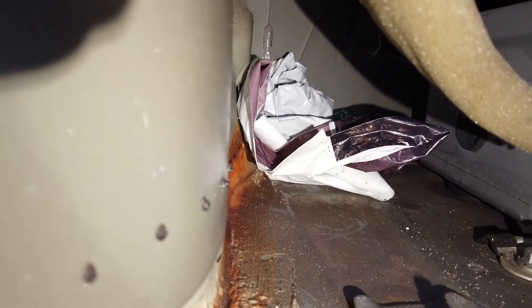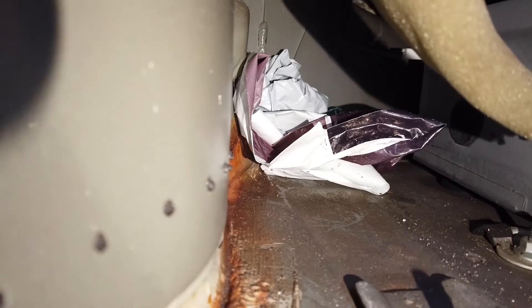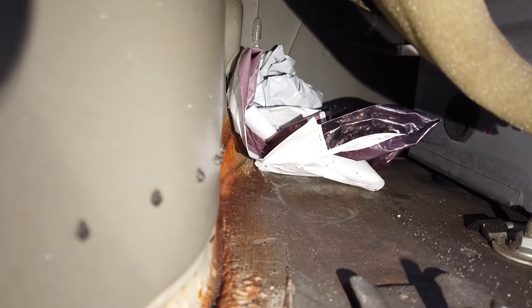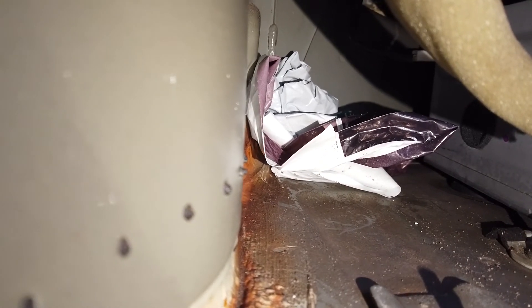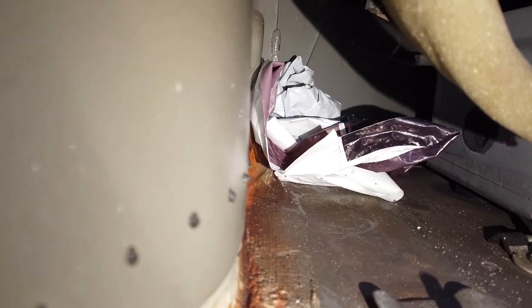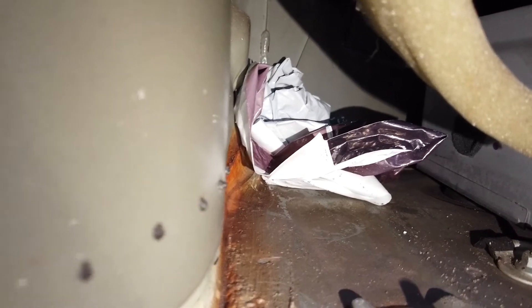As you drive it's just going to roll around the back and accumulate. What you'll see is there's a gap on this side of the car and one on the opposite side — this bottom bit of the chassis continues forward to where the batteries are under the seats. I've stuck a plastic bag there. Now I know this is not good for battery ventilation — that's what these gaps will be for — battery ventilation. So do this one at your own risk. The batteries do need to be ventilated, they need to stay cool — just be smart about that. I've done this to stop water going forwards towards the batteries.